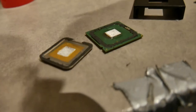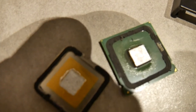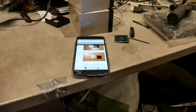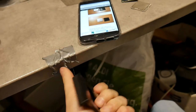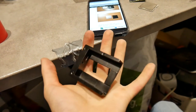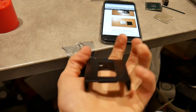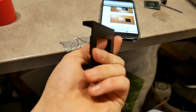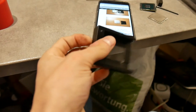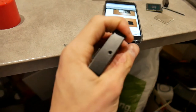I'm never going to get that right again, I'm sure about that. I didn't break it, because I would have seen crystals on here, and I can still see metal. Thanks for watching. It's an okay delidding kit. If you want to delid a Core 2 Quad or something, you apparently can. Should you really trust a $400 CPU to this thing from China? It's hard to say. If you don't over-tighten it, it's okay. You might even want to use the razor blade to cut on the edges to make sure you don't break your PCB.